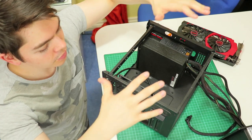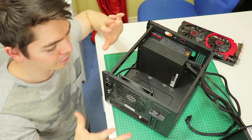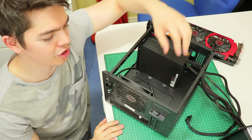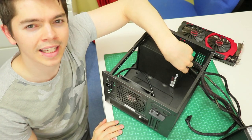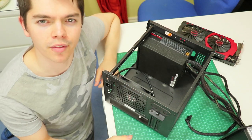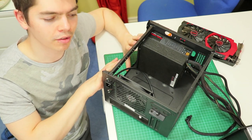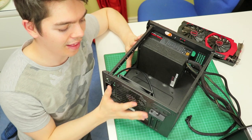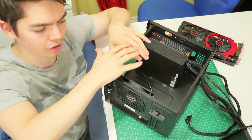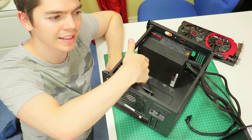So anyway, in terms of cooling, let's say with your 160mm power supply unit, for the CPU there's going to be basically nothing from the front. There is a small ventilation strip here, but the GPU is going to be basically covering that or taking quite a lot of that. So very minimal airflow from the front for the CPU, the VRM for the motherboard and the RAM. So you're going to be predominantly relying on the ventilation strip to the rear, to the side here, and then the fan to the rear that's pulling it through in sort of a 90 degree phase across that zone there. So you might want to perhaps remove the filter from the inside of the panel there.